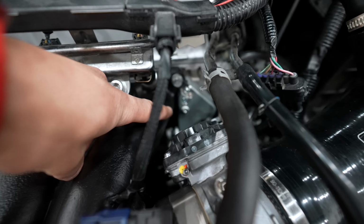However, after the track, I did two little mess ups. So number one was that. Number two was I absolutely cooked these brakes. So the brake pads that are found in here were definitely not adequate enough for the racetrack. If you guys were here in person, you could feel these massive grooves that are in here. So the front pads and rotors absolutely need to be replaced. The rears are decent, but it can't hurt to replace them too while we're at it.